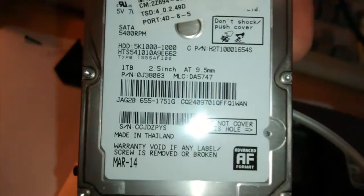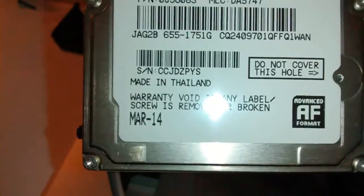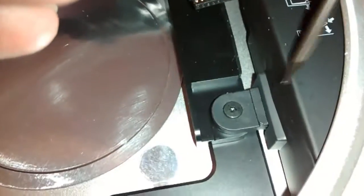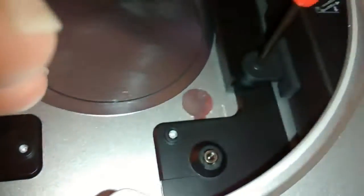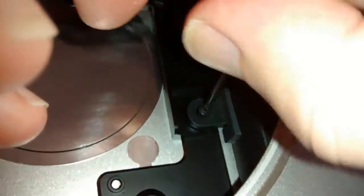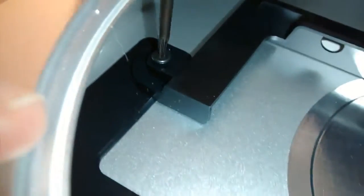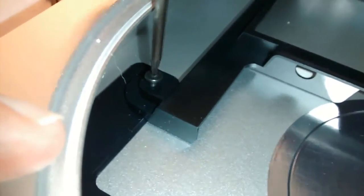We're making some progress now. There's the SATA connector for the hard drive. Pull the hard drive out of the machine - lift it and pull it. That's your hard drive. 5,400 RPM - it's a Hitachi one, March 2014, very new. Let's put that to one side. To remove the two T6 screws - one here and one here - that holds the power supply and hard drive bracket in place. Be very, very careful not to strip the heads, but unscrew them confidently.